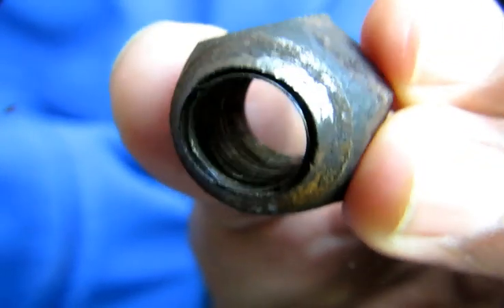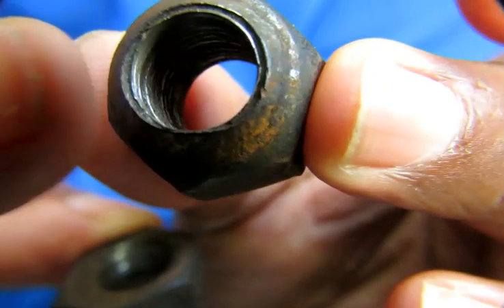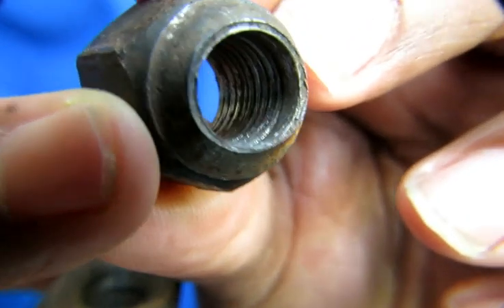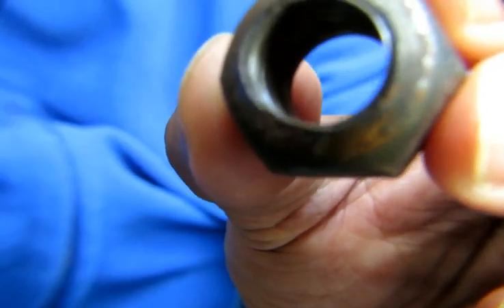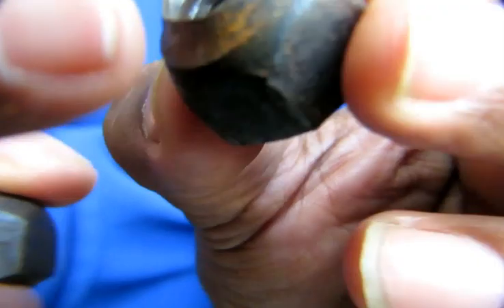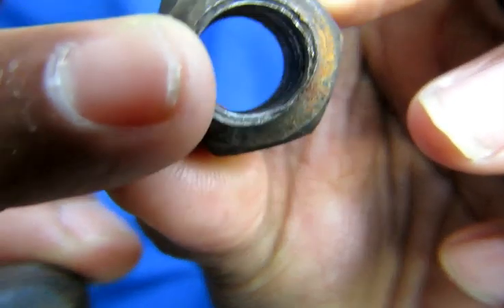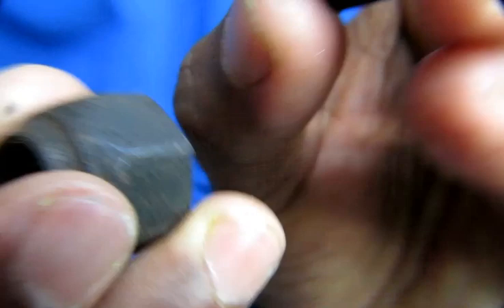The reason I made this video is to show you what happens if this nut is worn out. In my case, I think the mechanic used a big torque or air wrench and the nut was put in at an angle. The inside lining of the lug nut got damaged and became very loose.